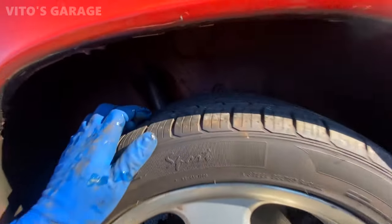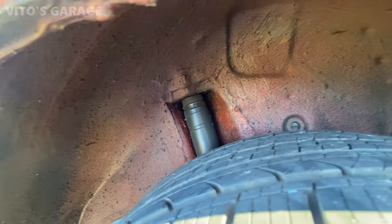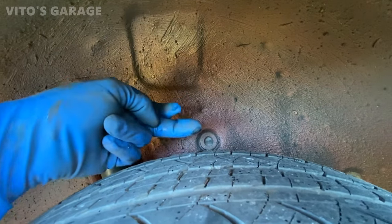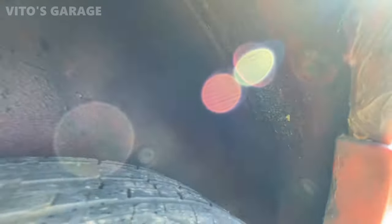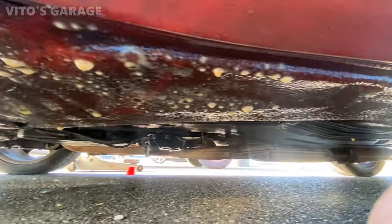I fluid filmed this side about a year ago and this is what it looks like — as you can see there's still grease and everything is being protected. Not too much debris sticks to it; initially you may get a lot of debris sticking, but eventually this is what it's going to look like — nice and protected. Some of you are probably thinking once you apply grease and fluid film and start driving, all the dirt is going to stick to it. Yes, some dirt will stick at the beginning, but then as you keep driving that dirt will keep falling off. And remember, even though dirt sticks to the grease and fluid film, there is still a huge film of protection between the metal and the actual stones, rock chips, or sand sticking to that grease.